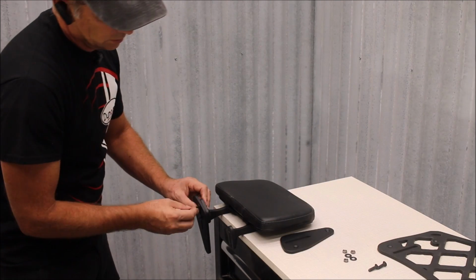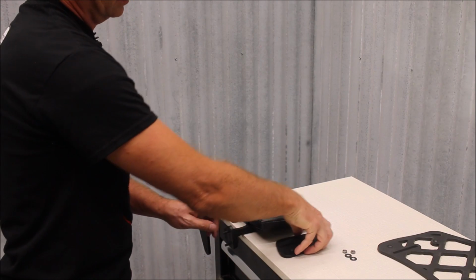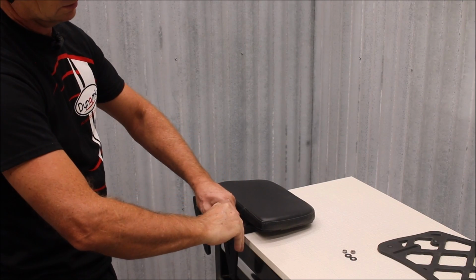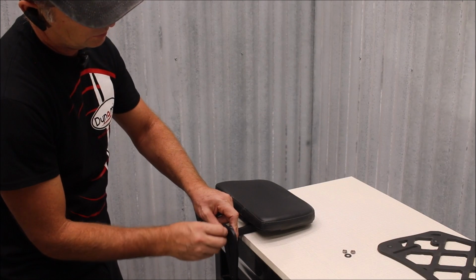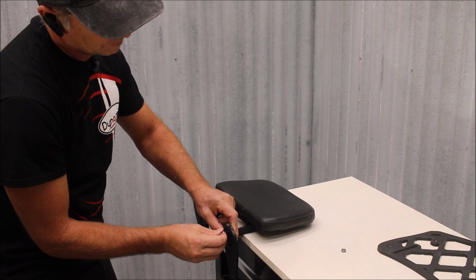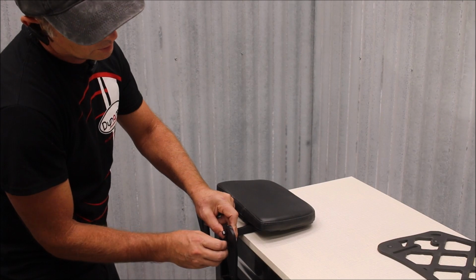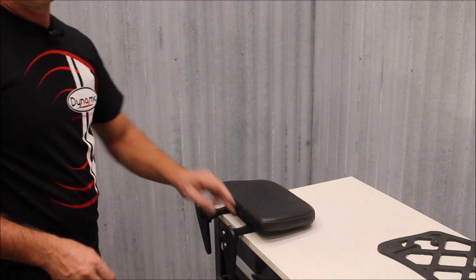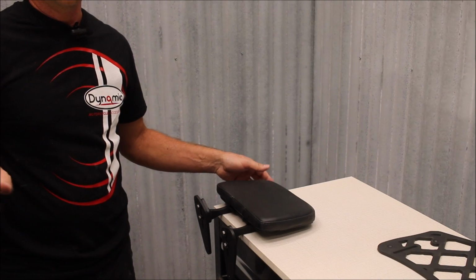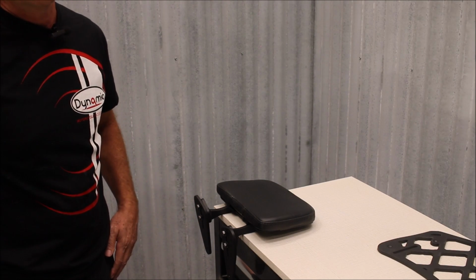Washers. Next bolts through. And then just pull this plate the same way, just straight up. Set it over the bolts. Then before you get these lock nuts tightened all the way down, you can just double check on the bike just to make sure that you have the mounting plates in the correct orientation.